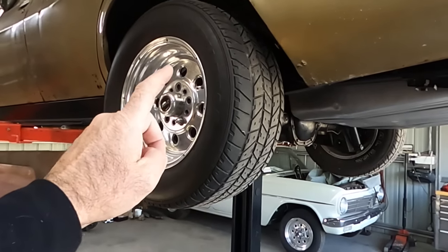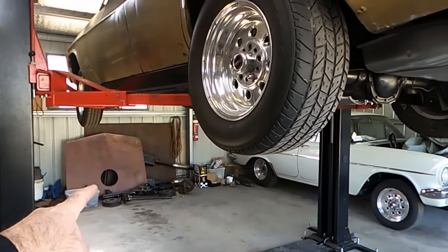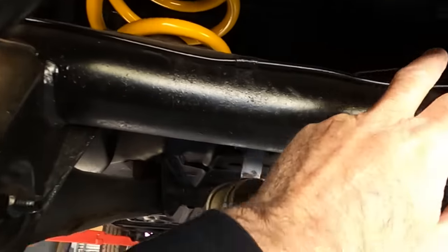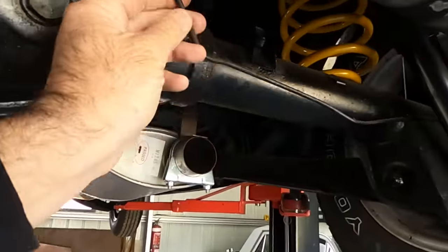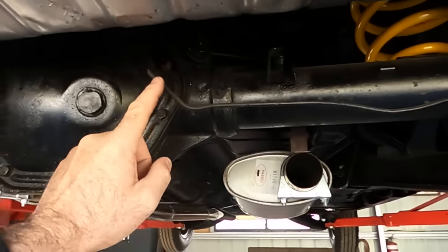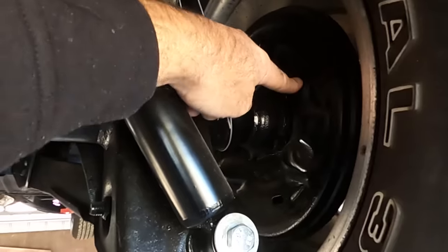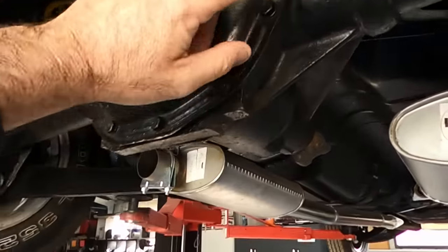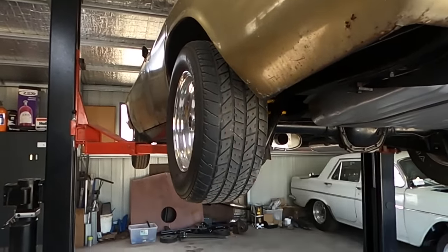First thing we're going to do is get the drum brake backing plates off this guy, because they've got to be swapped over to the 9-inch housing. And we're going to unbolt the control arms here, and also at the top up here, take this guy out. And I remember I borrowed a brake line for the white HQ, so that's actually out of the white HQ, but I've screwed it back in there to keep the fitting. Those backing plates there, and we'll probably have to remake these lines to go over the 9-inch. So wheels off, get into the backing plates, get them off, which axles have to come out. So we'll get into that first.